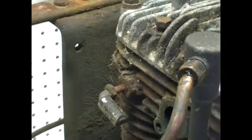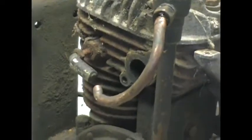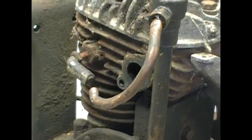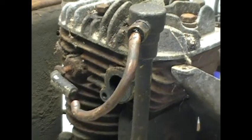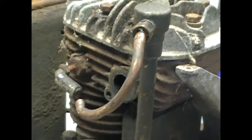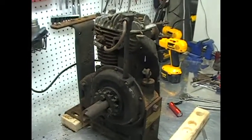I know that at one point there were compression relief valves. Basically, if you were hand cranking it, because this does have the ability for a hand crank, you would relieve the pressure in the cylinder so that you didn't get any kickback. You'd open this little valve, and as you hand crank it, the engine would start to kick over, and then you would shut it real quick, the compression would come back, and the engine would go into its running cycles. That's my only thought until I get in there. It is sitting at the top of the head, and the only thing I can think of is it's some sort of compression relief for hand cranking, because it's on the same side of the engine. It was kind of in an awkward spot, so I'm not quite sure.